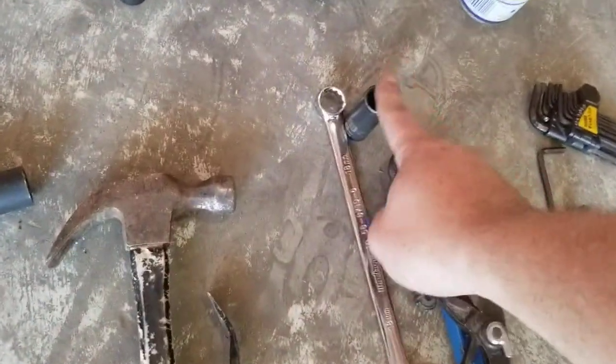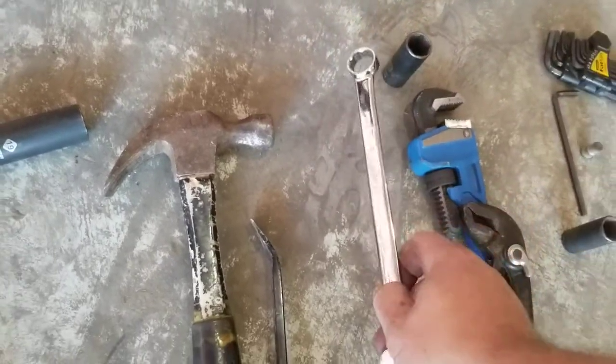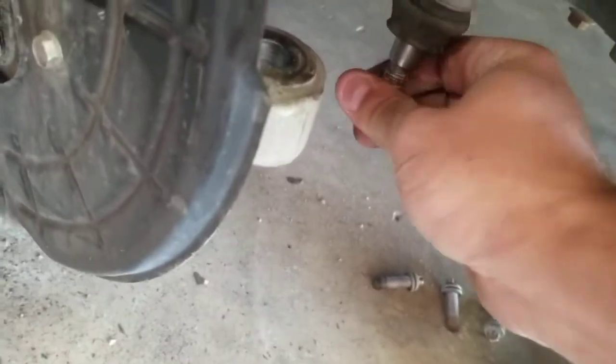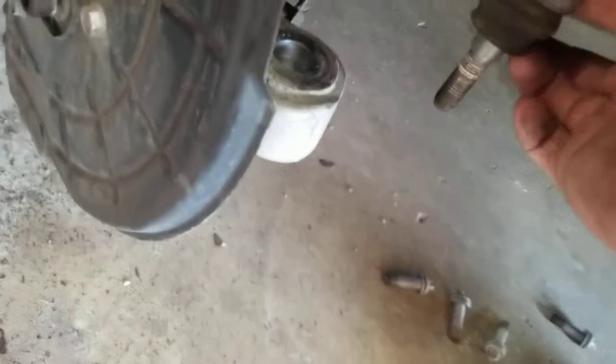If you do decide to take the tie rod off, this is what it is. It's an 18 millimeter socket. I ended up having to use a ratchet, and I tried getting a pipe wrench in there somewhere. I know it's not good for them, but it just wanted to spin. It was just spinning along with me loosening it, so that was a pain. I tried to get a wrench on there